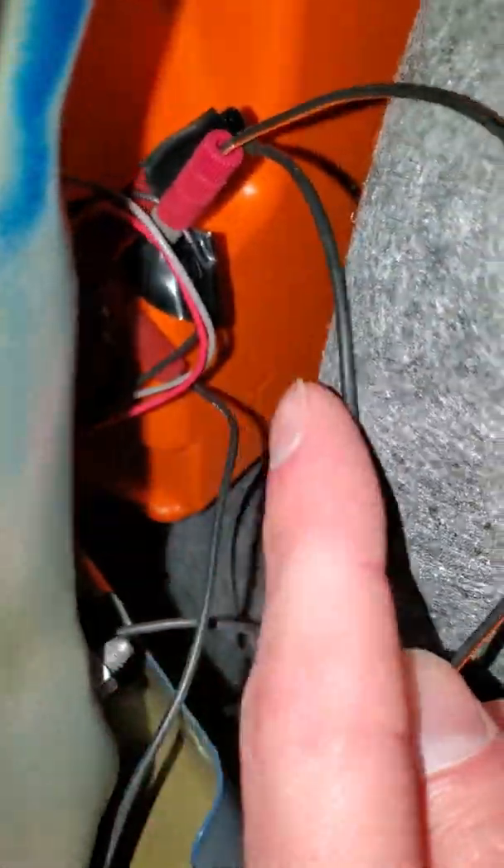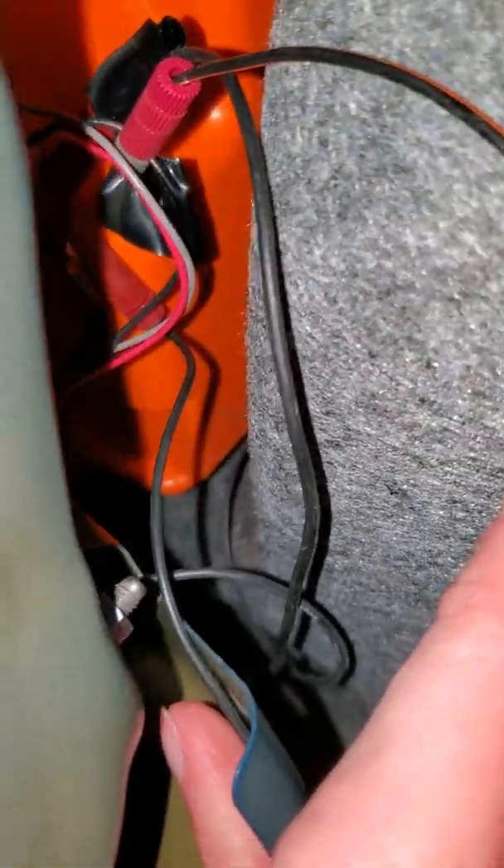So this is kind of hard to see, but this one wire is going to the ground. This wire right here is the signal wire. So that comes from the front repeater and that makes the yellow turn signal work. And then the last wire is connecting here, and that diverts the old signal from the brake and turn signal — it's one wire — to this little tiny green resistor here.